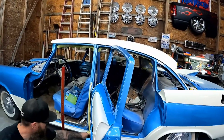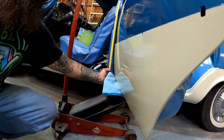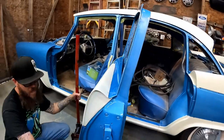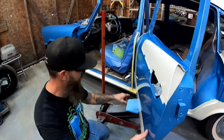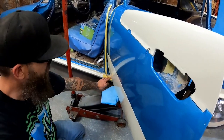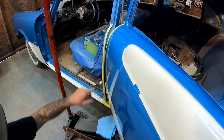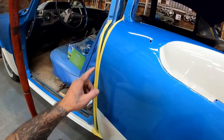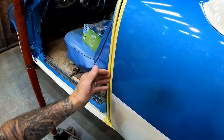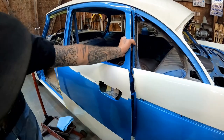Down at the bottom where it meets the rocker panel I'm just getting a slight — maybe an eighth-inch gap — so the two panels aren't rubbing together. We definitely don't want to start closing the door and have it gouging into our rocker panel. That's the first thing I want to do — make sure it's not rubbing. I put a little tape down there just in case. The tape will come in handy right now when we're shutting this — if these two edges rub together we won't have to worry about paint coming off the edge. Let's go extremely slow — no latch yet.